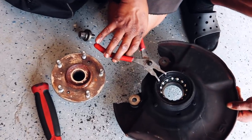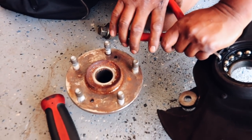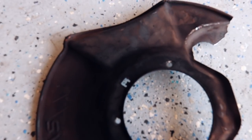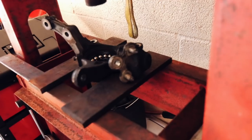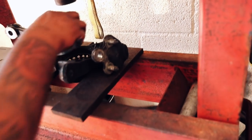If you've never done this before, you gotta use a long bolt like a crank bolt - you don't have to, it's just easier. Hammer that out. A long bolt works. The brake dust heat shield is removed now. The problem with removing it is you're gonna have a lot of heat issues when it comes to your lower ball joint, but that's why you use foil tape. When you use foil tape it prevents your ball joint from wearing out faster.